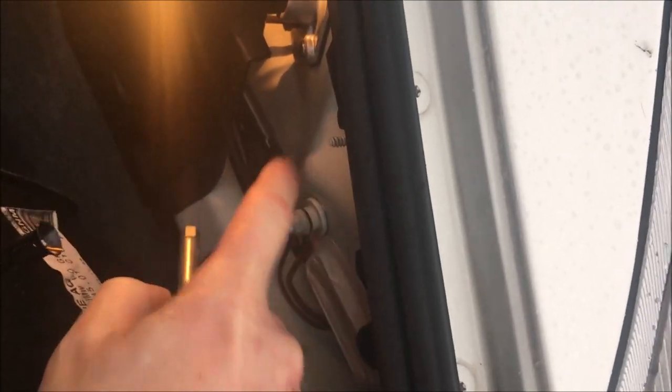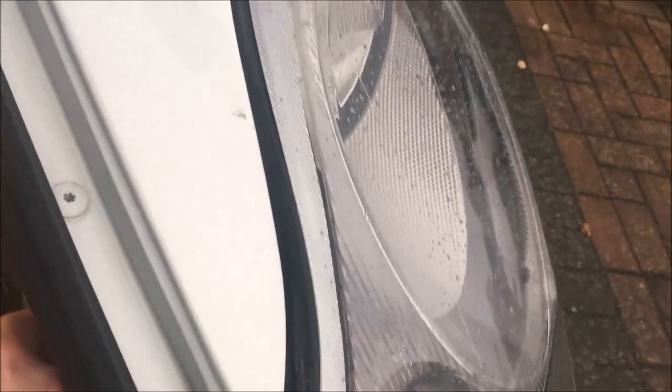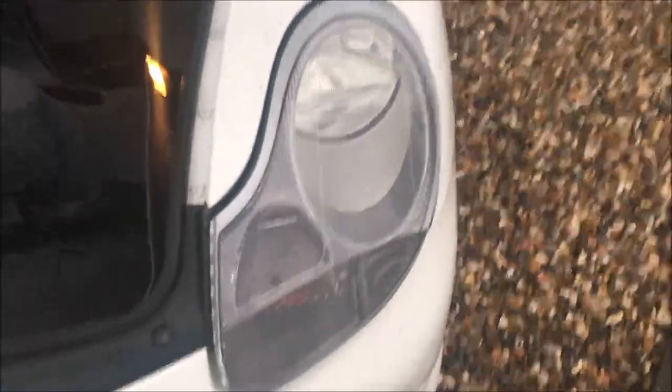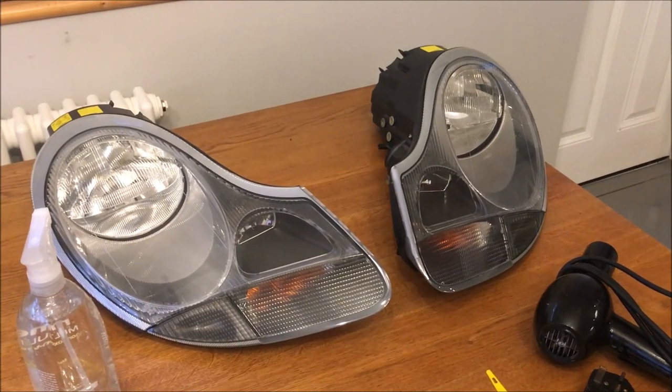Removing a headlight is pretty easy. You just need to pull back this carpet — there's one tab which goes on this little fixing here. You unscrew that and pull this rubber plug out of the hole. Then once you've got all that dismantled, you take the headlight removal tool from your kit, slide it in, and arc it towards the back. As you arc it towards the back you'll see the headlight just pop forward. You can then slide the head unit out of its fixing and pull it out.